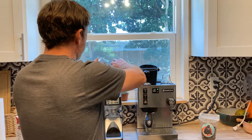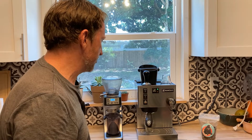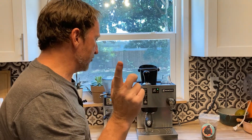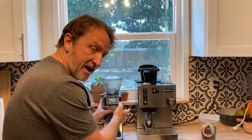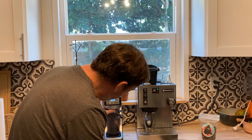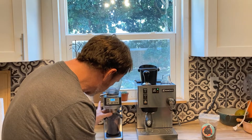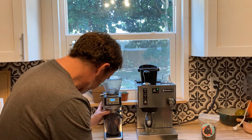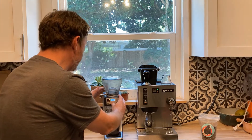If you've followed my past videos, you'll know I was having problems with my Sette 270 from Baratza — but the truth is it was not that at all, it was my OPV valve on the Rancilio, which I have fixed now. Check out that video if you're getting super pressure out of your Rancilio — that could be one of your issues. A good rule of thumb with the Sette 270 for espresso is around setting five; I've got mine at three with the micro setting about midway.